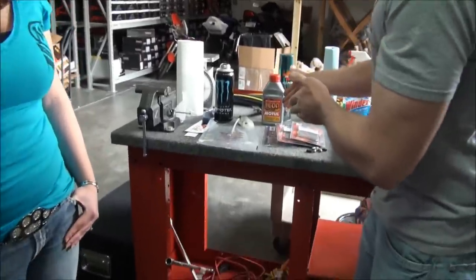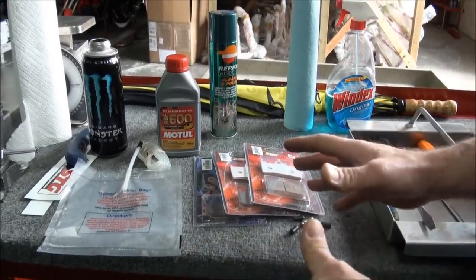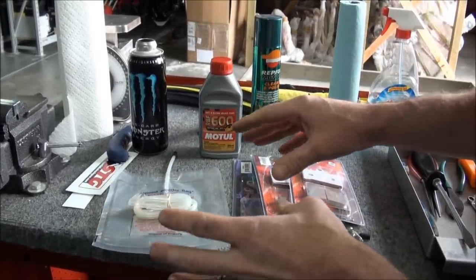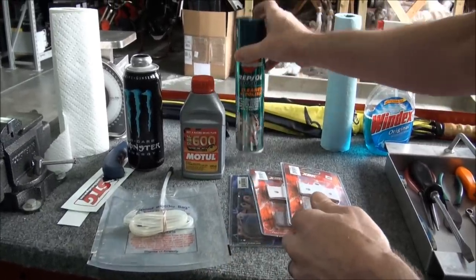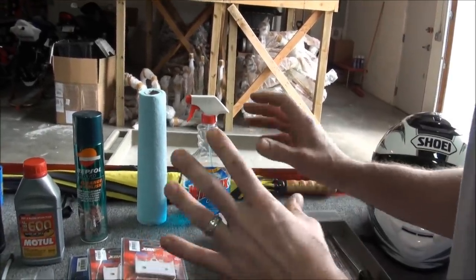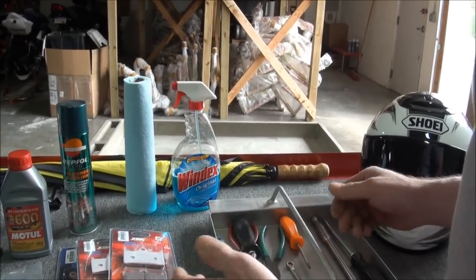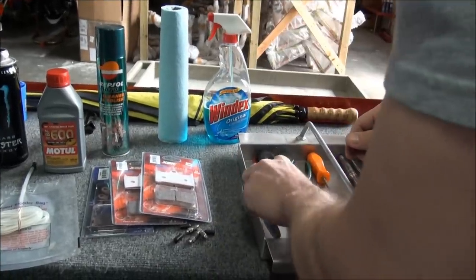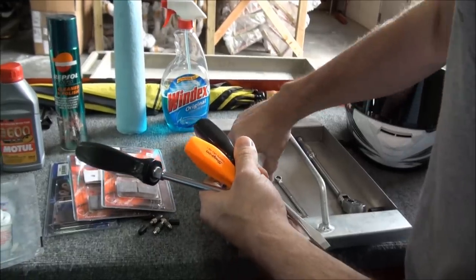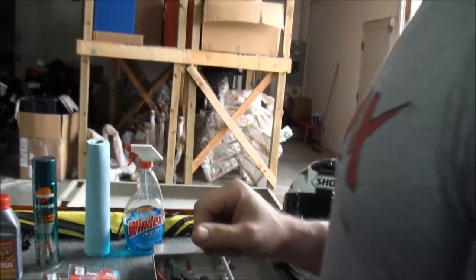When we replace the brake pads, we're going to flush out the brake system and put some new Motul RBF 600 in there. We're going to put three speed bleeders in — it's going to help us to change the brake fluid quickly. The things that we need to do this job are, obviously, brake pads front and rear. We're going to use a speed bleeder recovery bag and hose — it makes the whole brake bleeding thing no mess. We need brake fluid, brake cleaner, our speed bleeders. I like to keep handy a roll of paper towel and some Windex or just some water-based type solvent. If you get a little brake fluid on your bodywork or your painted stuff, you're going to want to hurry up, spray it off, wipe it off so it doesn't have time to damage the paint. For tools on the R6, I've got a toothbrush we're going to use to scrub the caliper pistons, a couple of screwdrivers — a big flat blade, a smaller Phillips, a medium flat blade — some needle-nose pliers, side cutters, eight-millimeter wrench, three-eighths ratchet, and a 12-millimeter socket. And that'll be enough to do this whole job.